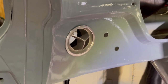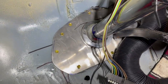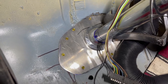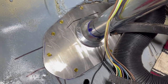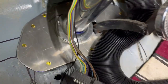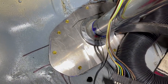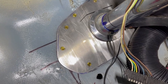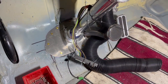Here's the brake pedal plate that I put in. The way I did this plate was I took a piece of clear Lexan plastic and put that where the plate now is — which has all the fasteners in it — so I could locate the hole for the steering column to go through. The steering column has an eyeball-type mounting bracket down low with a set screw that grabs the column. Over here you can see the bracket and the cutout for the brake pedal and how close they are. Using the clear Lexan, you can get all that figured out before you start cutting big holes. You can also match-drill the Lexan by locating your existing fasteners on it, then transfer that onto a piece of sheet metal — it gives you a pattern to work with.